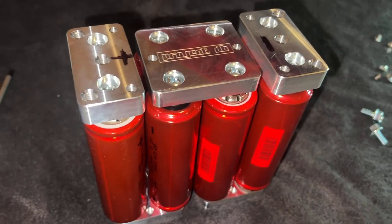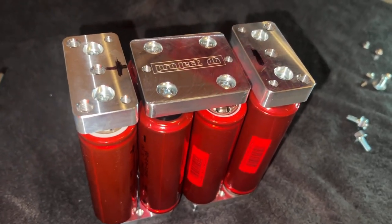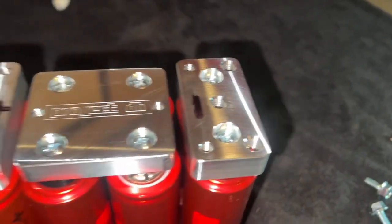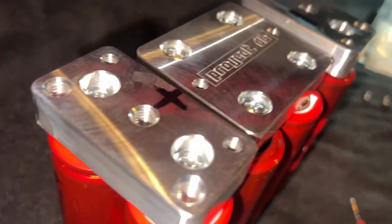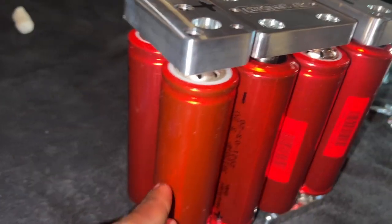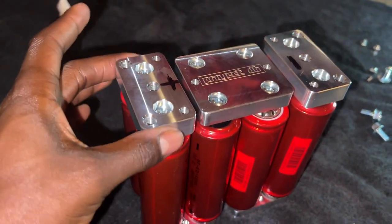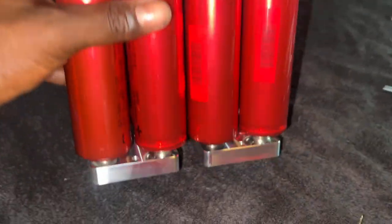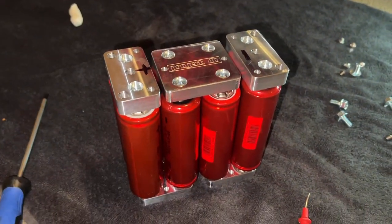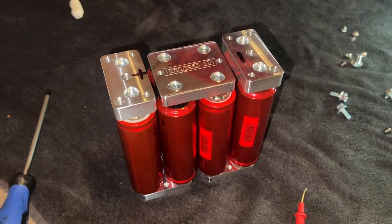I don't want to lie — I don't know much about these so I can't really tell you how much power they actually hold. But I'm guessing with a small bank like this, a 1000 to 1500 watt amp will handle it with no issues, because it's lithium, not AGM. I'm pretty sure this little 16Ah bank could handle anywhere from 1000 to 2000 watts, especially if you got a high output alternator. I hope this video served y'all some justice. Like I said, fairly simple — positive, negative, positive, negative — put your end caps on, mark them so you won't get them mixed up. Drop a like on the video — it's your boy, bass at it.